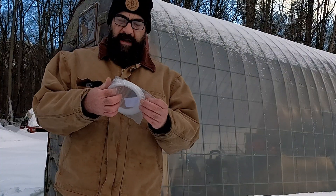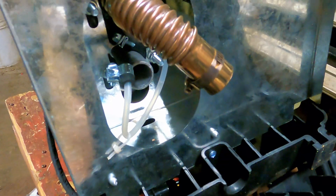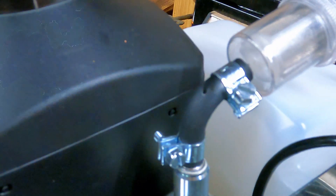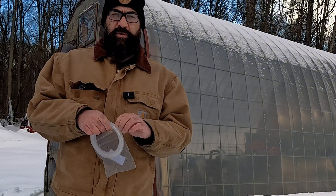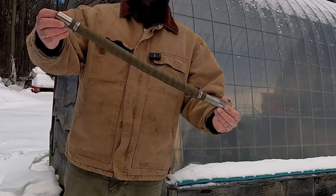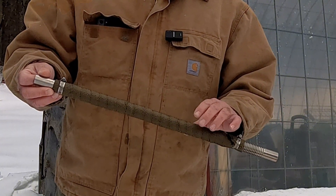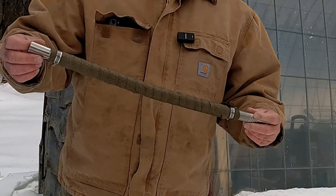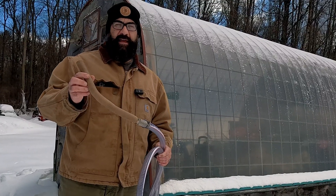The first modification I did was upgrade the fuel line. I'll show you a short clip of what it looks like installed — it has rubber pieces on the ends to convert to the size of the filter and fuel tank, and it comes with hose clamps. I'll put links to all these products in the description below through my Amazon influencer page. The next upgrade is titanium exhaust wrap — high heat rated — which keeps the heat off the outside of the pipe so you don't get burned if you bump into it. One roll is enough for one pipe.